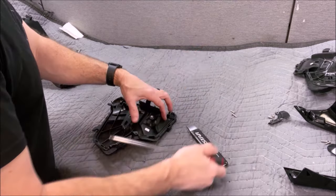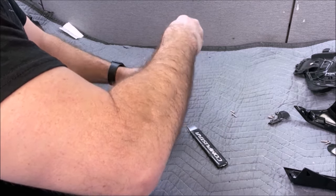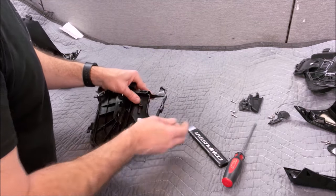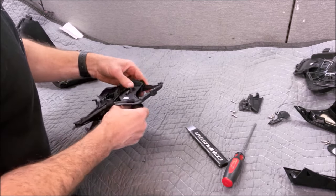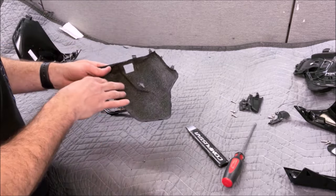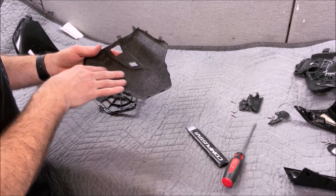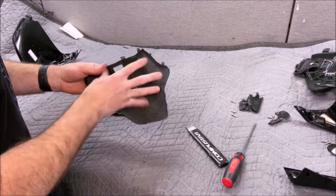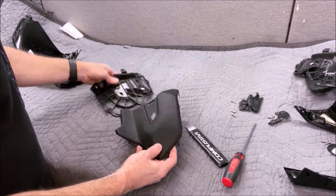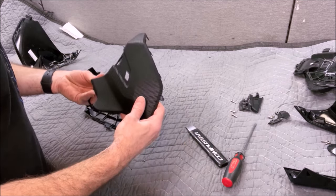On the side with the latching assembly, you'll need to remove that screw as well to get clearance to take it off — you won't have that on the other side. Once you have this apart, you'll notice the grill is completely perforated — no blockage of any kind from the grill itself. The main thing is this carpet or fabric — don't cut too much away so it can droop later. But since it's completely covering the entire grill, any modification you make will be completely invisible to the eye once reassembled. It'll look completely factory.